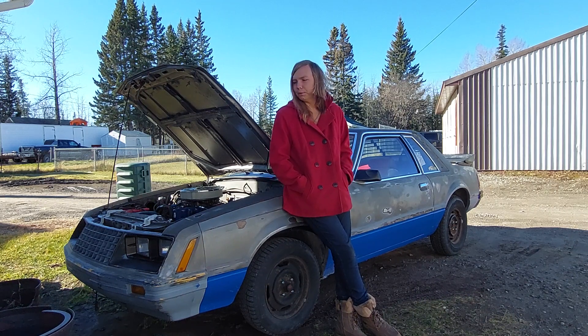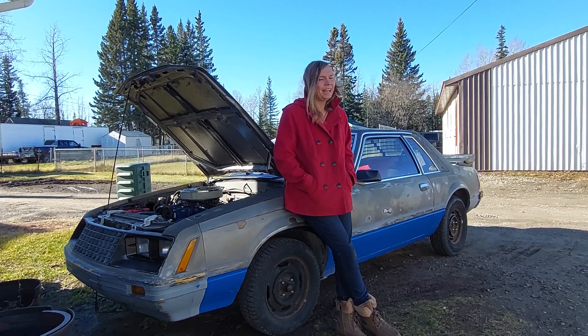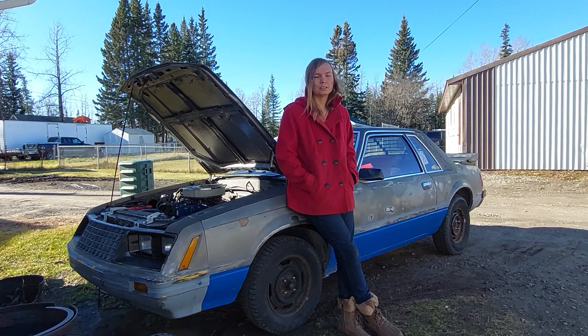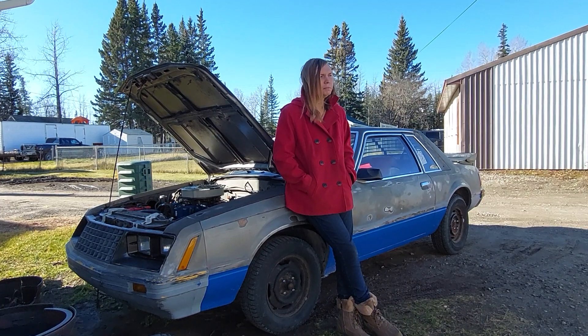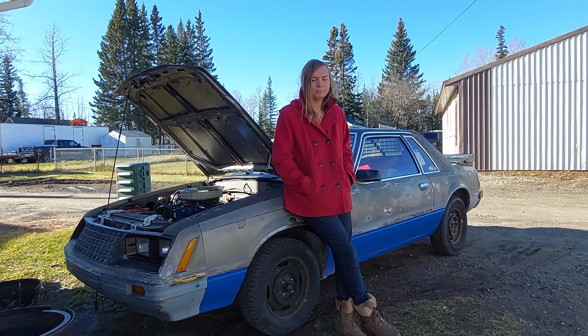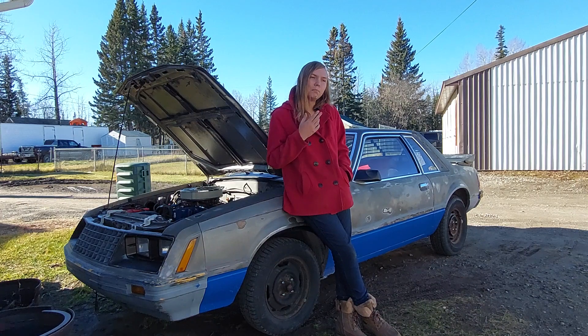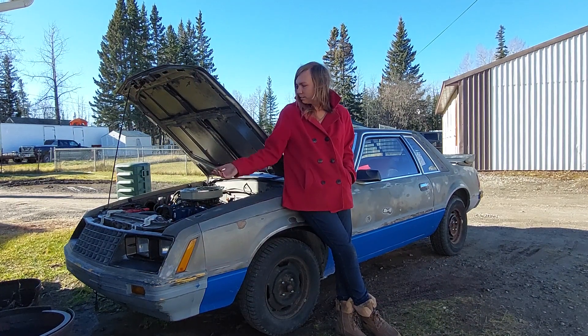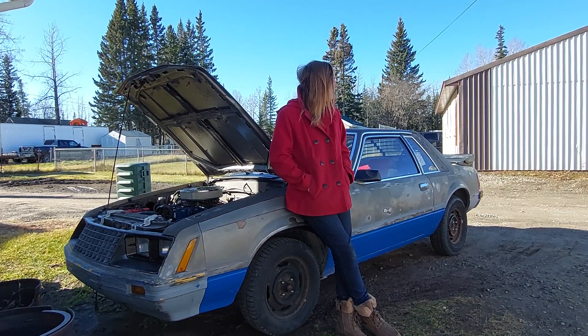I want to give a shout out to Roy from Marco's Garage for helping me out with this, and his buddy Sandy too. Sandy basically confirmed what Roy was thinking — or they shifted it a little bit. Initially Roy thought ignition, but once he heard it start he immediately said timing chain, then drove it around and confirmed it. It's nice to get more than one opinion. At least I was correct that the jets were too big and it was running rich.